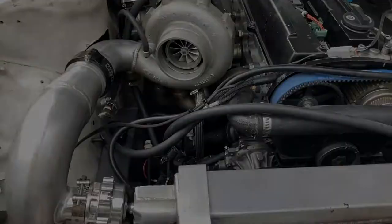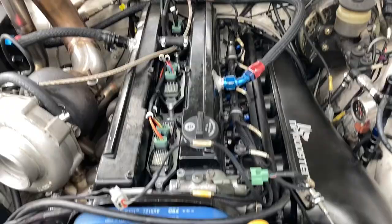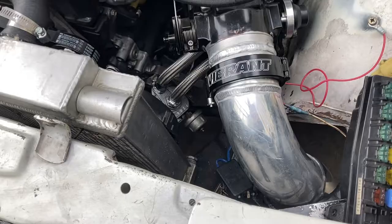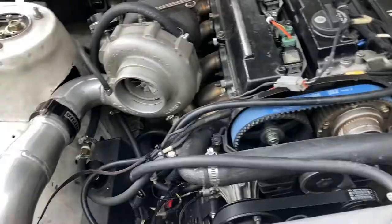What I really wanted to show you guys is the engine setup. Walking through some of this stuff — he's got LQ coil packs with a coil pack bracket I've never seen before, pretty cool. Got the NP Boosted intake manifold up here with a custom throttle cable. The fab work is actually pretty legit — he's got Vibrant clamps, a big six-inch core intercooler, a Garrett water-cooled turbo running a Future Fab manifold with twin wastegates, and the whole hood dump situation going on.